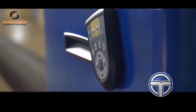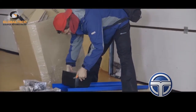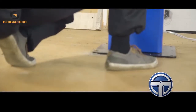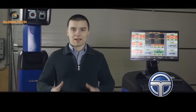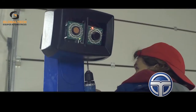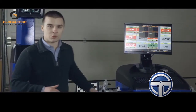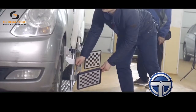Today we are installing a universal Techno Vector 7 wheel aligner. Techno Vector 7 is the first in the world truck wheel aligner that makes it possible to work with both light cars and trucks with wheelbases up to 18 meters. The machine vision system in such wheel aligners includes four cameras — two cameras to the left and two cameras to the right of the pit.